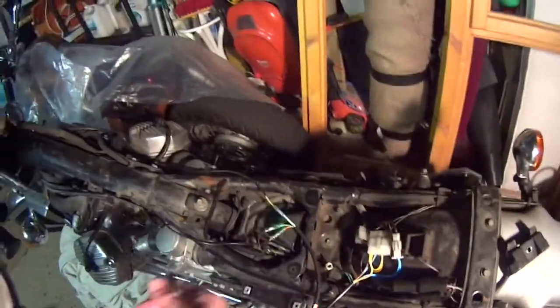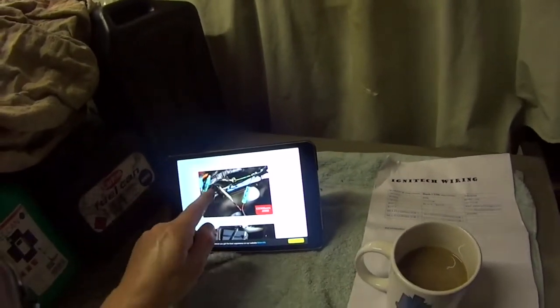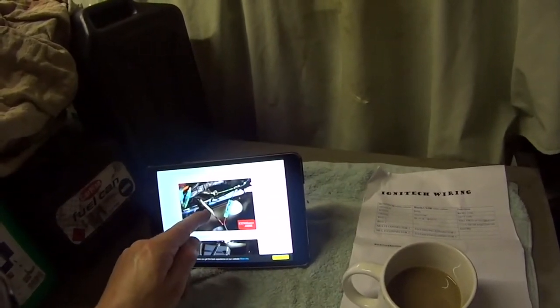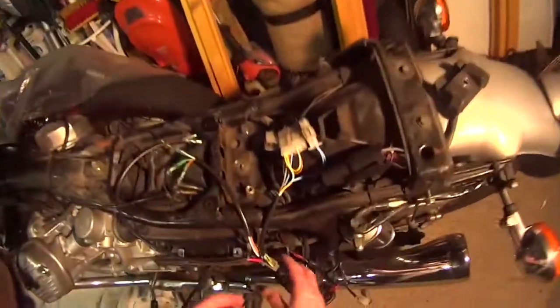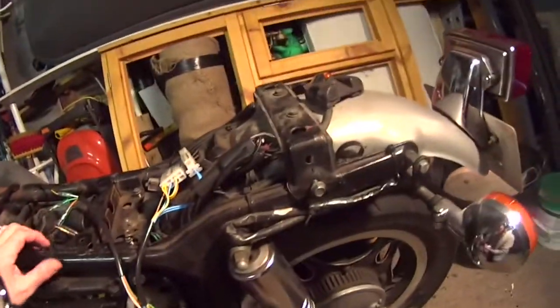So all we've got to do now is get a red connection. Let's go and have a quick look at that. So what I've got to do is find the black wire going to the brake switch, and that seems to be running alongside the green white, and then just unplug it and then plug the two ends of the red in, and you can see on the red you have got two different ends,